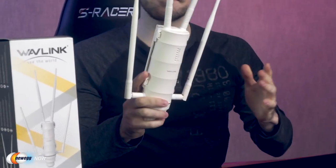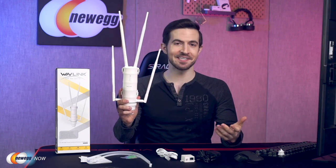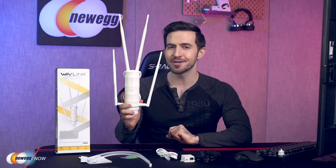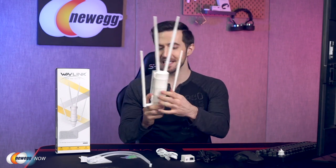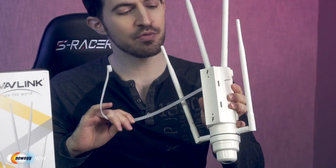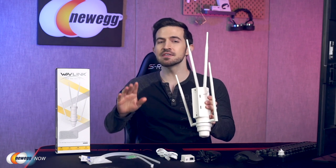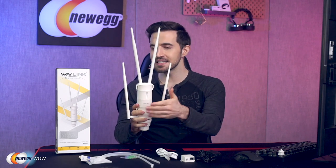And that's pretty much it. It's going to be very easy to install — it's designed to be an effective solution for outdoor wireless networking, so they've made it simple to use. With its centralized management platform and high degree of flexibility, it's the ideal choice for providing point-to-point, point-to-multi-point, and outdoor Wi-Fi coverage. You'll attach the external antennas, find some fixed pole or similar object outside, and thread the zip ties through the holes to wrap the kit around the object. Using the PoE converter and power adapter, you can turn it on — there's a very clear set of instructions in the Quick Start Guide to get you connected.